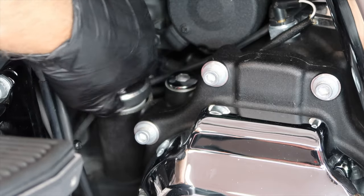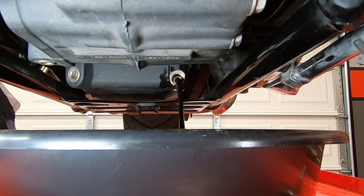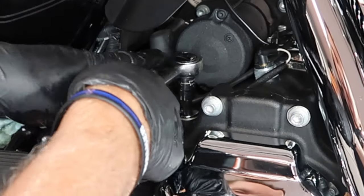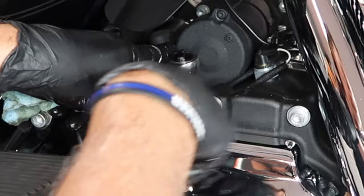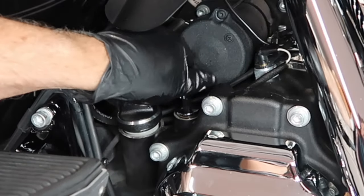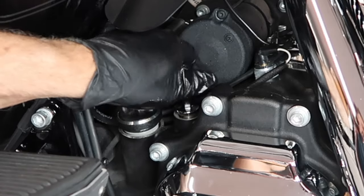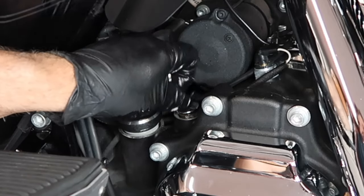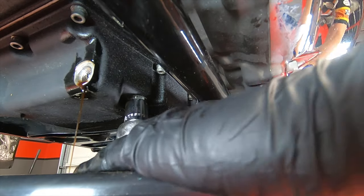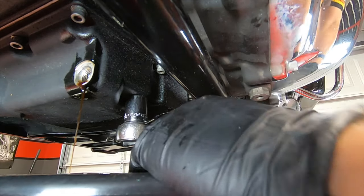Watch how the oil drain flow will increase. While I'm here, I'll take my 3/8 hex and remove the transmission fill dipstick, because that drain faces straight down and I'm not too worried about it rushing out. Not to mention, we're dealing with less than a quart of fluid inside the transmission. With the same 5/8 socket, I'll remove the transmission plug and allow it to drain.